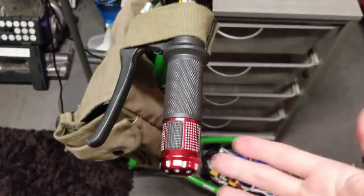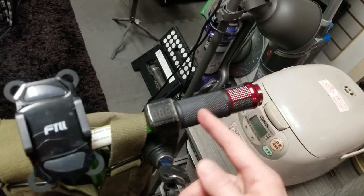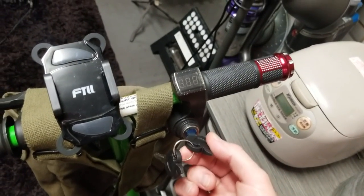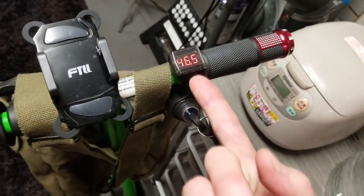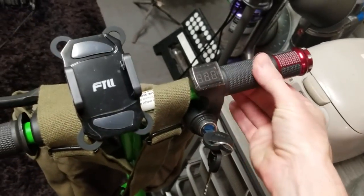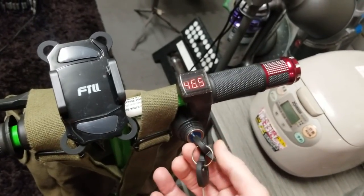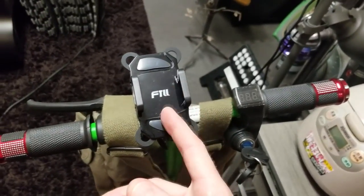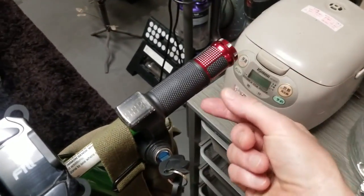Let me show you my throttle system here. I have my cell phone holder and a little canvas military bag on top. I put on my left grip and I have my throttle here. With this system the way I wired it, it will always stay on regardless of whether the key is on or not. But the key does show you the voltage — I have one battery pack that is not fully charged, that's why we see 46.5 volts. The scooter will stay on entirely. It's variable speed, which is absolutely fantastic.